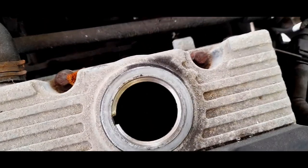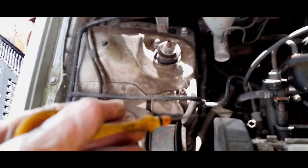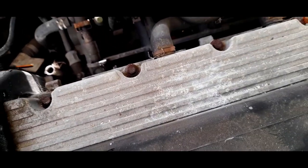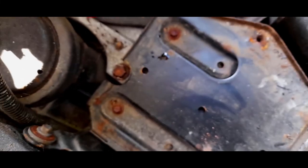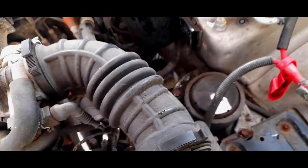Number one: drop the engine oil, because they're not going to change it for quite a while. Always take the cap off beforehand and put it somewhere safe. Top tip: take the dipstick out too, because that O-ring on the dipstick prevents air going down and creates a little vacuum. The oil is quite dark but as expected. Strangely there's no antifreeze on the dipstick. The automatic transmission fluid is just here — there is a bit of redness, well, it's turned to brown. That is not good — that's old oil.